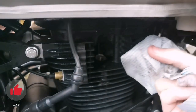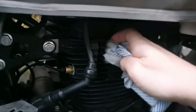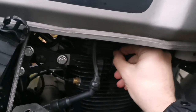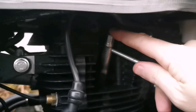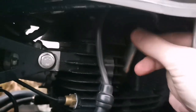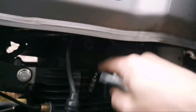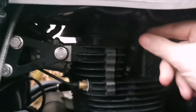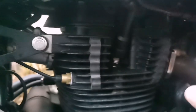I've got a little bit of WD-40 on a cloth here and I'm making sure the top is nice and clean - no gunk or anything - because I certainly don't want anything going inside the engine block. I want to just seat this in using my fingers only, finger tight down into the head, less than a quarter turn. I'm doing that nice and straight because if you're going to cross-thread it, this is when it'll happen. If you've got it at a bad angle and try to crank it, you can end up bending the plug or snapping it inside there. Just take your time and don't force it.